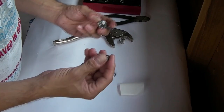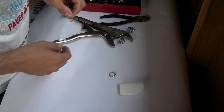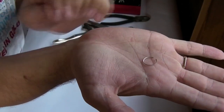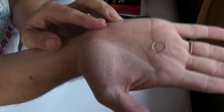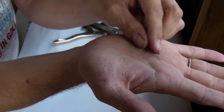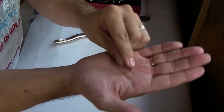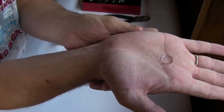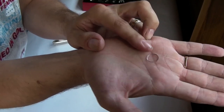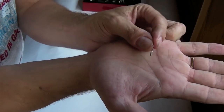Okay, the other thing that I want to show you while I'm in here, now I've got that, I'll put that in here so that I don't lose it, because that's the one. I did do an oil change video, but I don't know if you can see this. Now, when I undid the sump plug, this was wrapped round the sump plug nut in the thread, and that is aluminium from the sump. And the reason why there's no video is because I basically spat my dummy out big time. I wasn't happy at all, and the person who I got this bike from has got a lot to answer for. Luckily I've got video evidence of all the work I've had to do on it since I acquired it. Anyway, whoever did the oil change over-tightened the sump plug, probably realised they had done so and then stopped. So basically that's why I'm now doing this helicoil job.